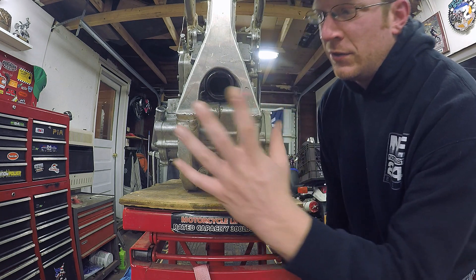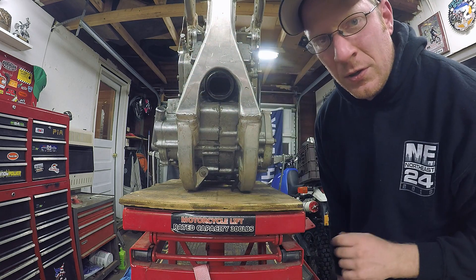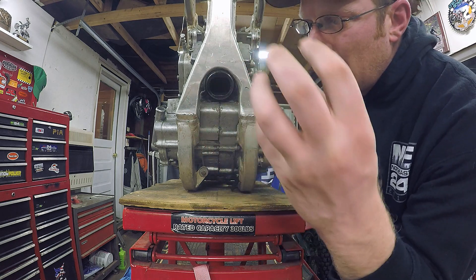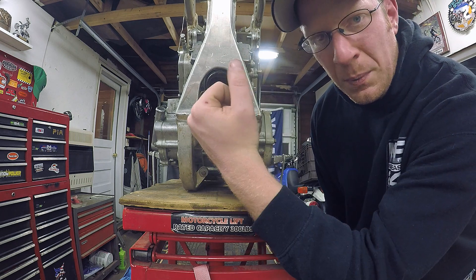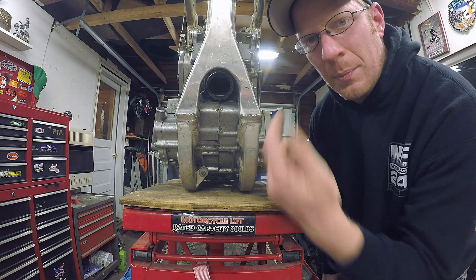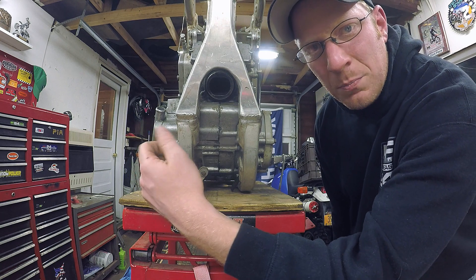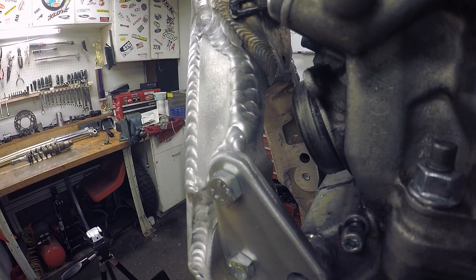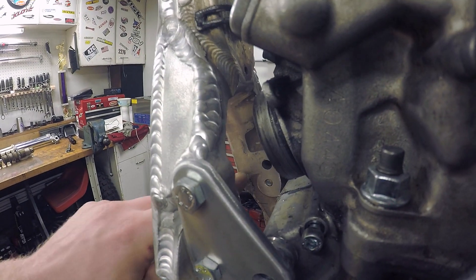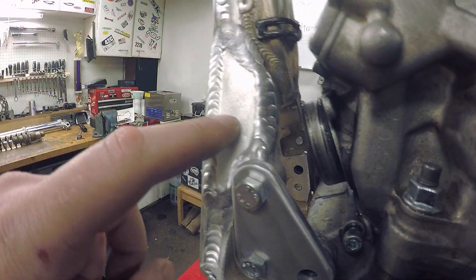With doing that, they had to put a piece of quarter-inch plate to reinforce it here and two pieces of quarter-inch plate on the sides, reinforced as much as they possibly can. The result is basically the perfect hole for the exhaust to fit through. I can get one of the springs on — the other spring is kind of blocked, so I might have to move one of the hangers on the pipe itself. The mount over here for the skid plate actually works perfect for that lower mount on the exhaust pipe or the expansion chamber. You can see all of that webbing is gone, with just a little bit left on the inside. Here's the quarter-inch plate welded in, and that front Y plate is welded on.